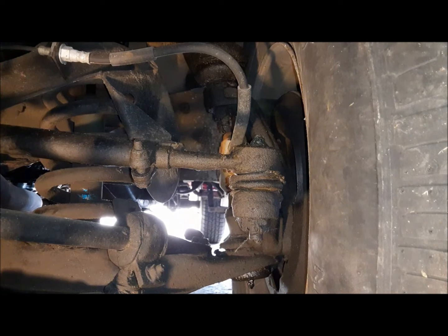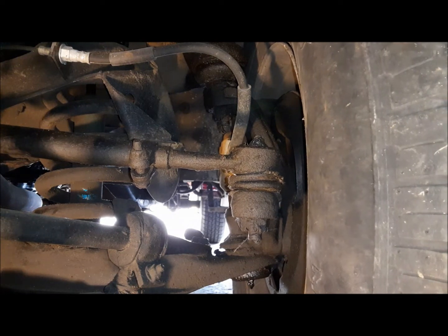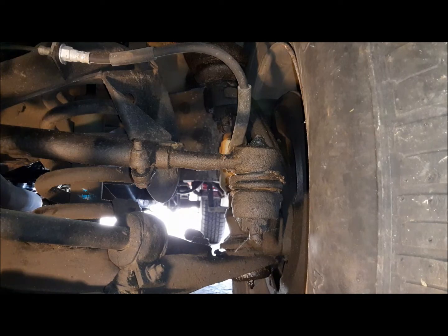On this side, you'll see we've got a tie rod end wiped out. Watch when I jiggle the wheel. See that? We'll have to put a tie rod end on this side — that'll be a left outer. And over here, we've got the same just tiny little bit of play in the wheel bearing. That's okay.